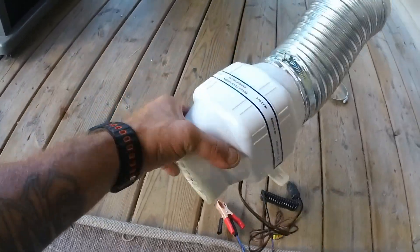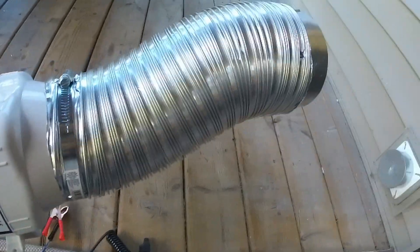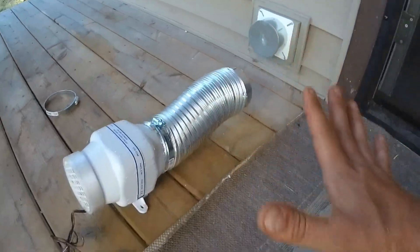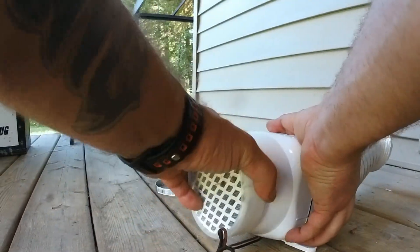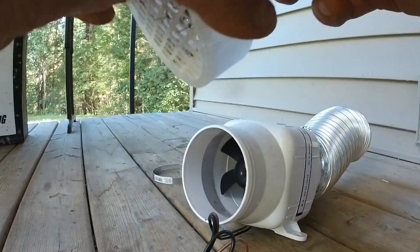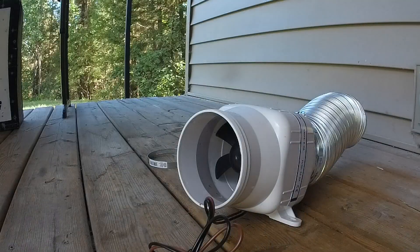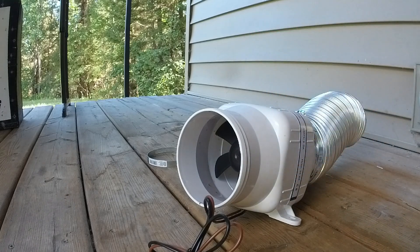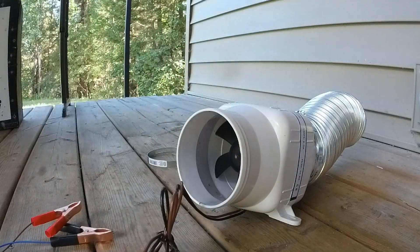So we have an inline blower — usually you'll see these in a boat — with just a two-foot connection there, an adjustable connection hose like you'd see on a dryer or washer, and then I 3D printed this front piece. I designed and 3D printed this bug screen, and as you can see there are bugs on it — it's a good thing I did. What this does is draw cool fresh air during the night into the cabin to keep us cool. I've got a couple clips on there and a voltage regulator to adjust the speed of the fan.